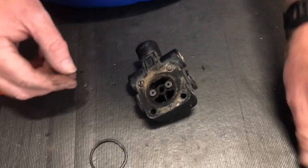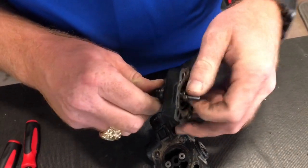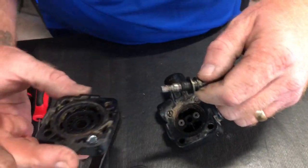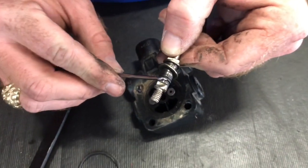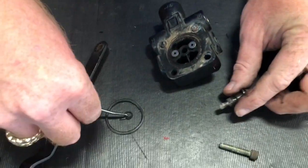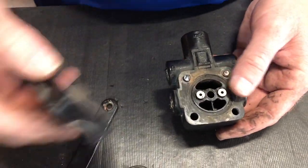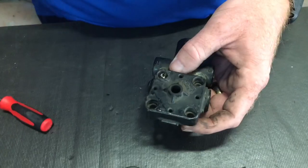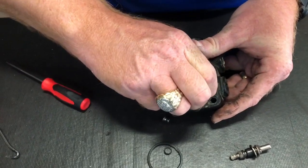Here's what's inside it — it's nothing more than an O-ring. And inside this piece, you've got another O-ring right here. So that's two O-rings. Inside of these is a spring clip. And how we knew this one was bad — when it was all back together, when you pushed on the arm, you'd hear a psst sound. And that comes from these right here. You can see they're spring loaded down in there.